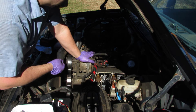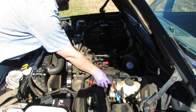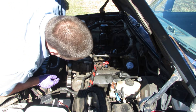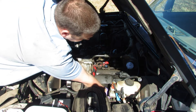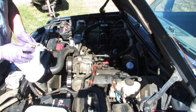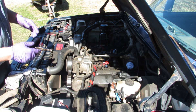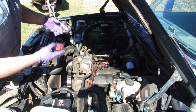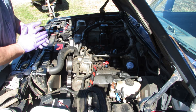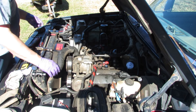I've got the diverter spouts on, then I went ahead and put the valve covers on loosely with just one bolt in each side. It looks like I might want to tighten them down a bit better — I've got a little oil dripping out already. I might put one bolt in the bottom and one in the top to help seal everything up, because my goal is to turn the engine over and blow out any oil and junk that's in the combustion chamber. These are 13-millimeter head bolts.